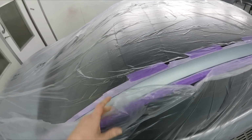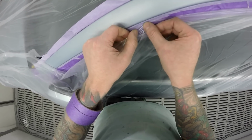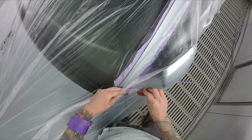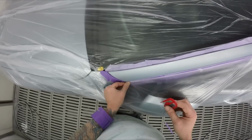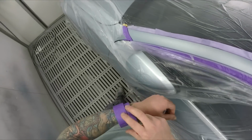And as I said, this color was pretty bad, so I did have to tip about 300 mils to the side, because to continue matching it, I would have ended up with like 1.5 liters. So I'm going to use that stuff that I tipped out at the start as a bit of a ground coat. I'll put that down first and then continue on with the proper color.